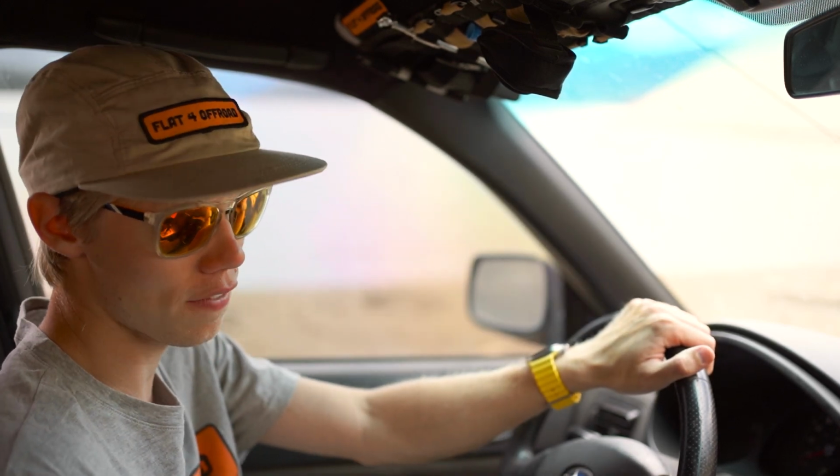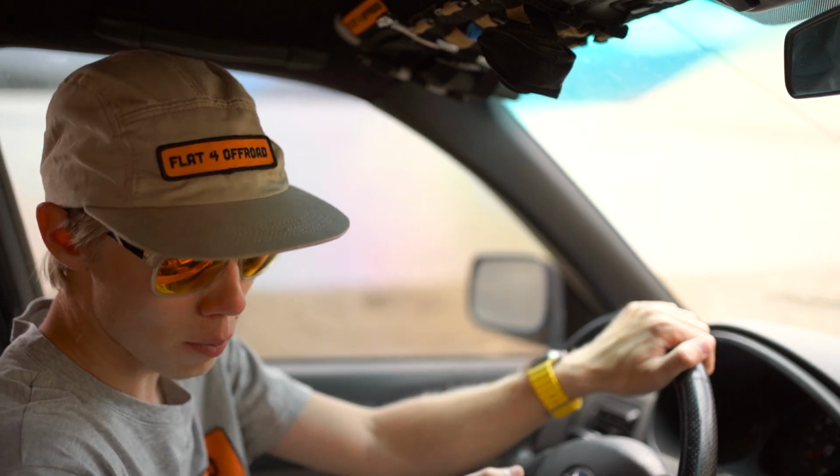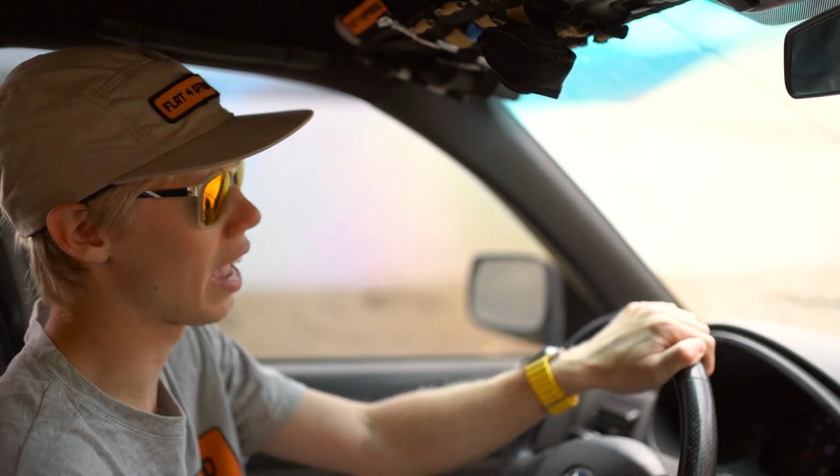So make sure you have a little bit of separation and, if you can, communicate by radio and let them know what's going on up front. If you're getting stuck, say, hey, hold up, I'm going to need a rescue here in a second, I think. But first, try to reverse out. Can't reverse out? Say, hey, get that recovery strap ready and let's go ahead and get this car out of the sand.